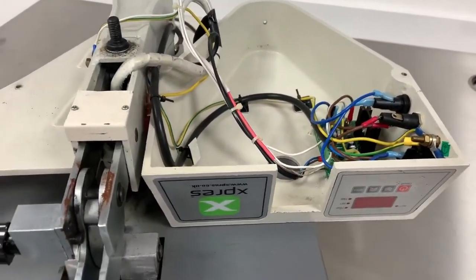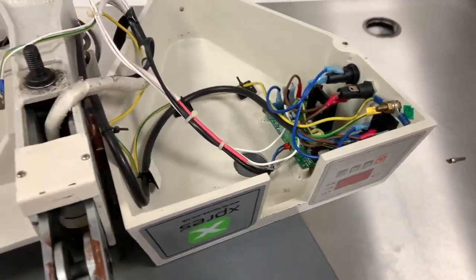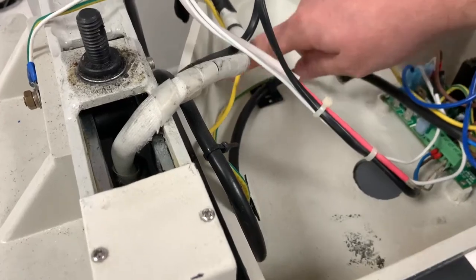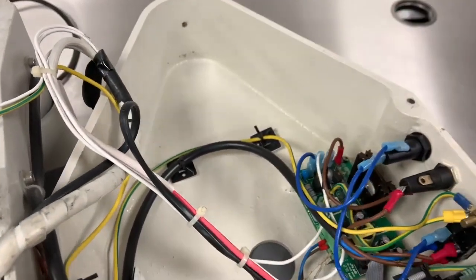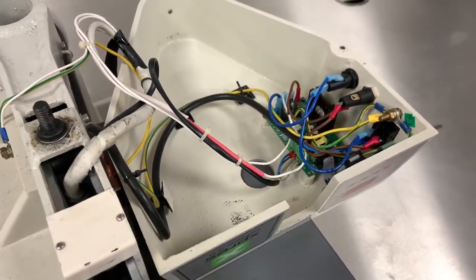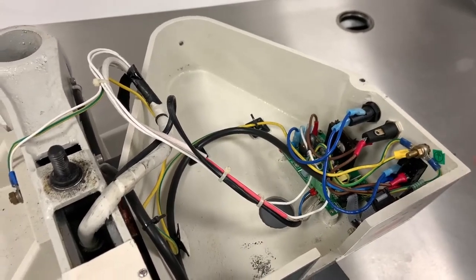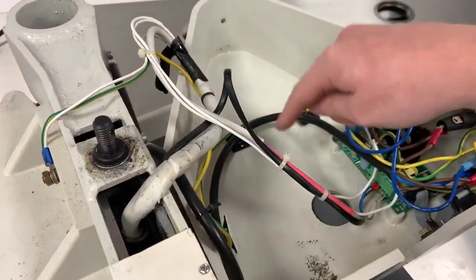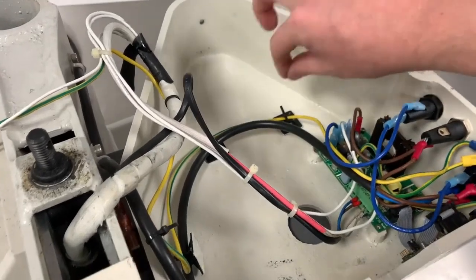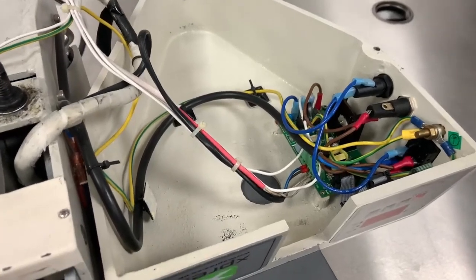However, on some machines it's not going to sit like this — it won't go completely 180 degrees — and that's because this sheathed wire is normally stuck around the edges of the machine. We actually remove that because we don't find it really helps at all. So if your machine has never been opened or repaired before, more than likely you'll find this sheath will be stuck around the edge and you can't flip it all the way over. If it is, feel free to remove the sticky pads and then you should be able to remove the cover nice and easily.